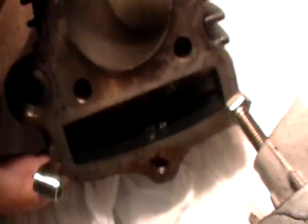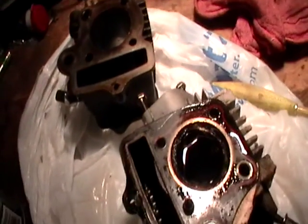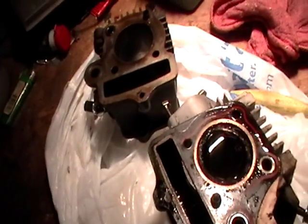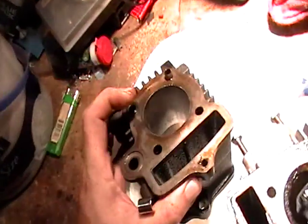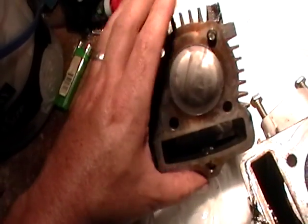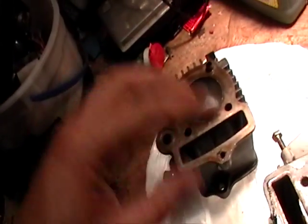I wish I could show you the piston, but I took that in to this little Chinese knockoff four-wheeler place — they have a whole bunch of them and you can also buy parts from them. I went there so I can get an exact match. I think I'm just going to get the whole new piston and hone this out. This is super smooth, there's no scratches, but I figured I'd hone it out so it'd give a new way for the new rings to wear in.